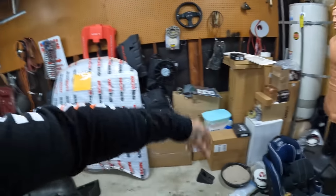So my plan is to possibly finally use this stuff and throw it in the other 350Z that we have outside. I don't want to do a head, I don't want to do a cam, none of that. I literally want to just do a bone stock LS3. The plan is to do it with flex fuel and 91 pump, literally no cam, no nothing, and then have AC and everything hooked up. That way it just runs super, super reliable, but gives you a little bit more.